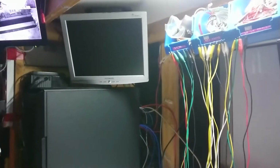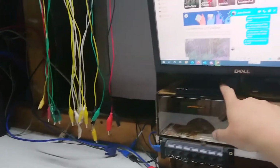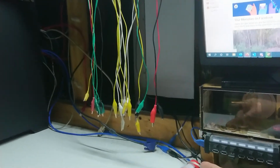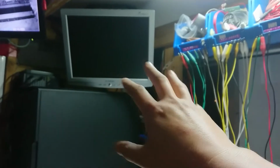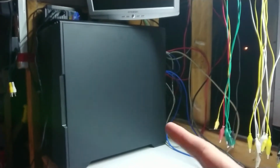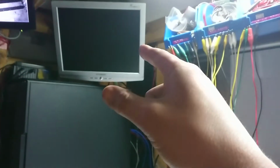Alright, so I decided I needed desk space back, so I've shoved it in its normal native position. And then I'm going to look at some USB extenders, USB 3 stuff, get this hub actually running. That probably doesn't need USB 3, so I'm going to put that on a 2.0 extension lead and save one of my 3s for something useful for my fly lead here. And I think I'm going to focus on getting third monitor happening. RGB really I couldn't care less about, but I did find that the motherboard has 4-pin RGB and the fans have 3-pin, so there may be some conversion needs to happen with that. I've got to do some homework, but for now, I'm going to try and get that working.